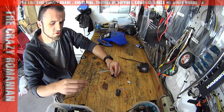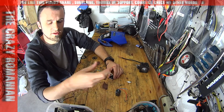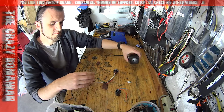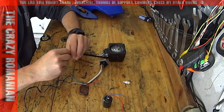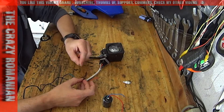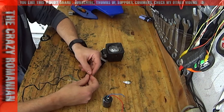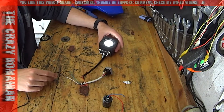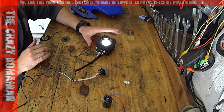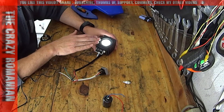I've connected the green and white wires to my power adapter, which is already plugged in. Right now I have direct current on this side of the rectifier. You could run an LED light directly from it — there is only one problem you'll have to compensate for. I'll show you first how it runs directly from it — connecting the black and the red to it. This is the light running off the direct current. It will run with no problem and won't create any damage to your motorcycle or power adapter, but it's not running at full power.